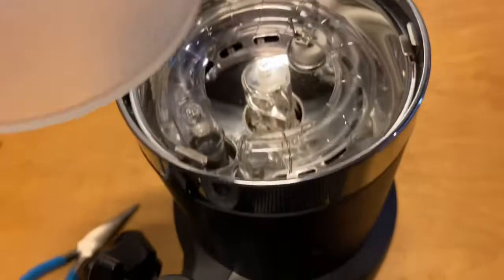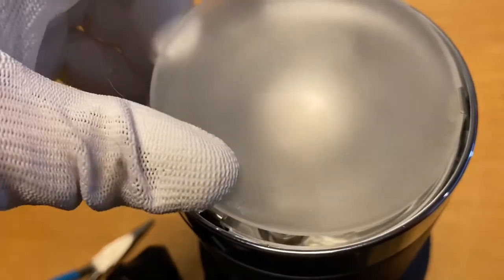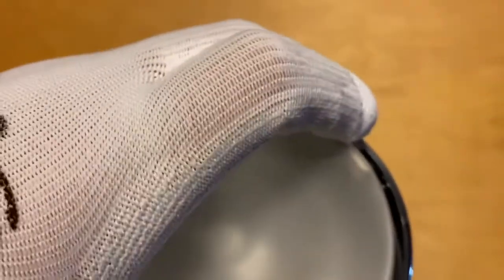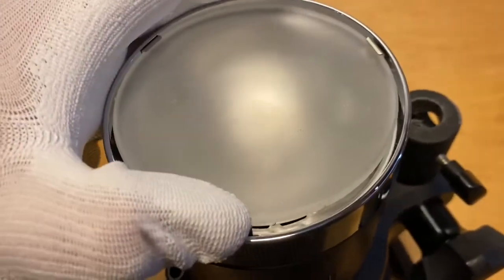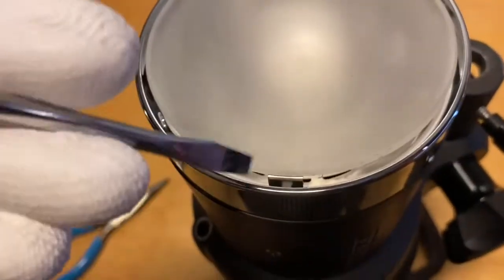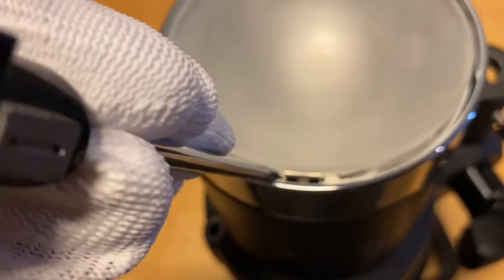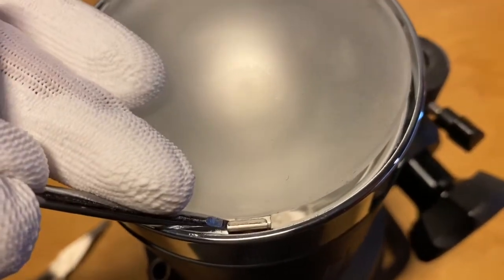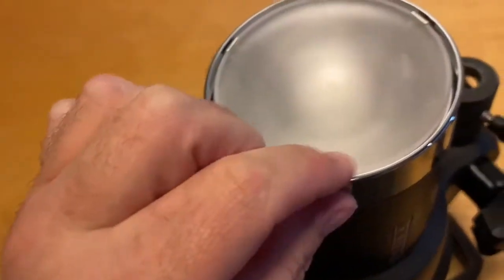The last step is to put the glass cover back in. Seat it in one clip — that's the secret — then come over and seat it in another. Pull towards you as much as you can, move the light around, then shove it the other way. Then use your little screwdriver to snap the remaining clips in. Just feel the edges with your fingers to make sure they're all in. And look at that — right back to normal.